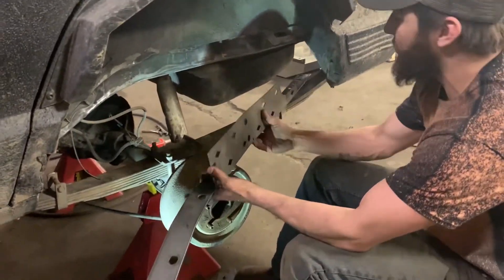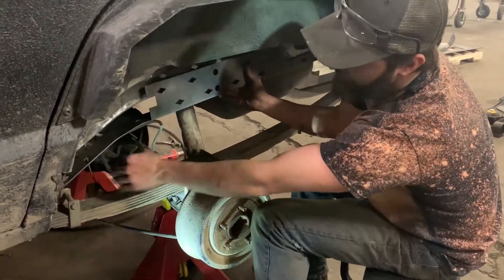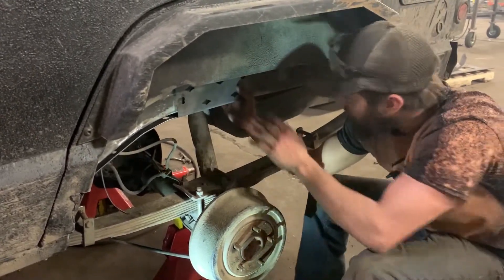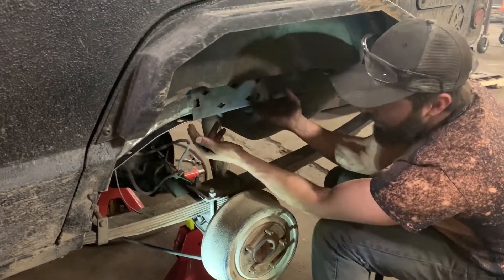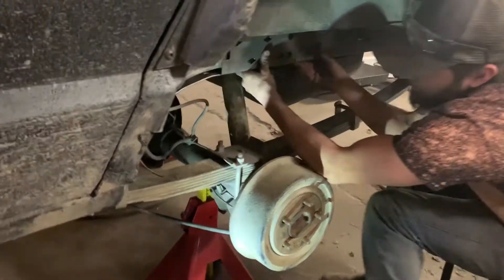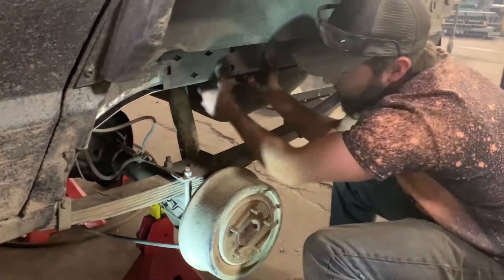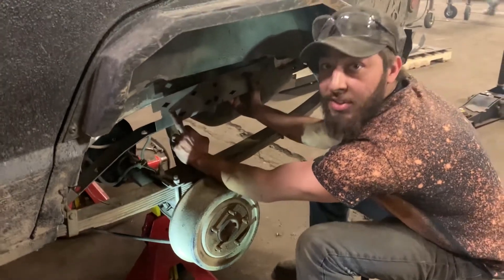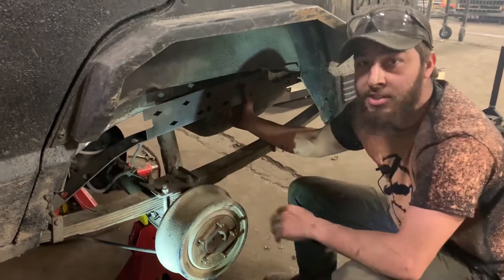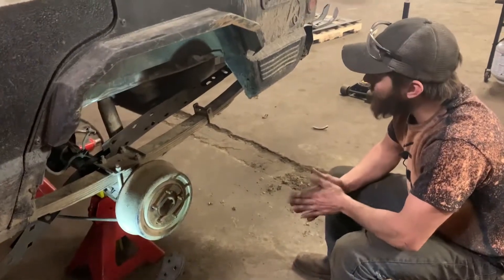Once you get everything out of the way and the gas tank removed, these stiffeners will be straight so you're going to have to bend them around to fit. Basically you just want to line everything up — you can use your bump stop and bolt that back up to actually suck the stiffener in. Make sure all your holes are lined up. I used quite a few clamps to get it nice and tight the whole way along. Before you put it in, mark it with a sharpie so you can clean all your edges where you're going to be welding, so you get nice clean welds holding these in.